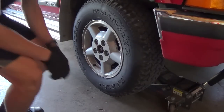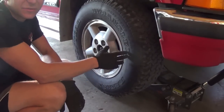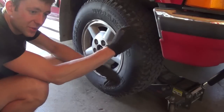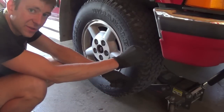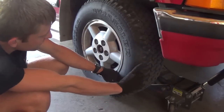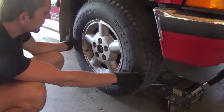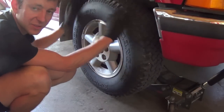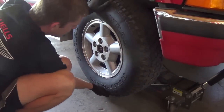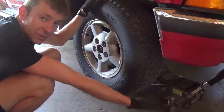When it comes to diagnosing bad wheel bearings, it can be a bit tricky. We took the truck for a test drive and noticed it was humming — a little worse when turning right, better when turning left. The next plan of attack is to raise one front wheel at a time using a floor jack just under the control arm, then spin the wheel by hand. If the bearing is bad enough, you'll actually feel roughness when the wheel turns. Check for play too — bearings can fail in different ways; sometimes they have play but don't make a sound.